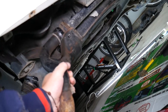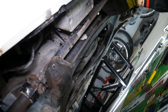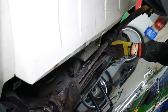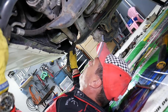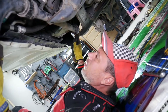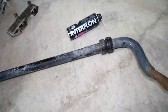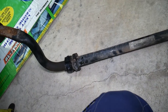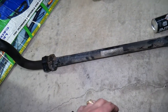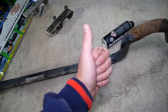We pre-loosened everything on this side already. We'll grab it here, lift it up, and see how to get it out of the suspension. We're hitting the oil cooler — let's see if we can get it out without removing it. We'll come this way a little bit, careful with the oil cooler, come out of the wheel well, angle it — and the sway bar is out. The bushings that usually go bad are on there as well. If you need to buy new bushings or a new sway bar, we'll share the links in the description below. That's how you remove the sway bar on a Volkswagen Touareg, Porsche Cayenne, or Audi Q7. Hopefully the video was helpful — thank you for watching and see you guys next time.